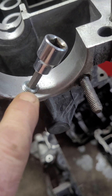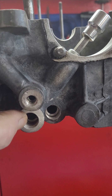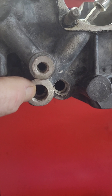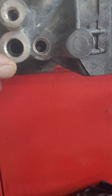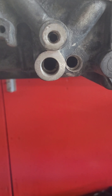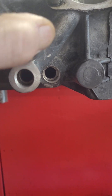I may have to just grind or file off the edge and pre-fit the pump in there. The idea behind that is when you bring your oil pressure back into the main gallery — when it comes out of the pump, through the filter, and into the full flow port that supplies all the oil to the engine — what happens is you get pressure going through the engine case and out to the main gallery, where it will pick up a signal for the oil pressure indicator light. But right in here, your pressure comes back against the pump.